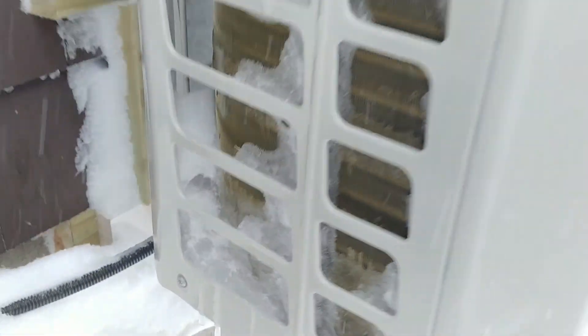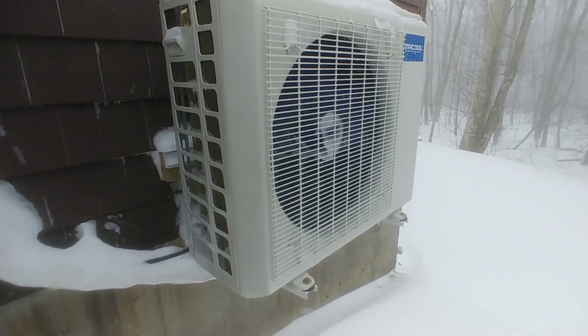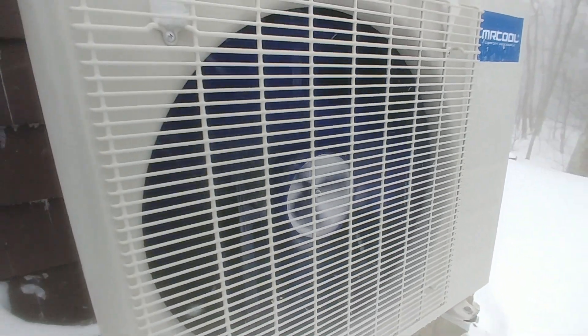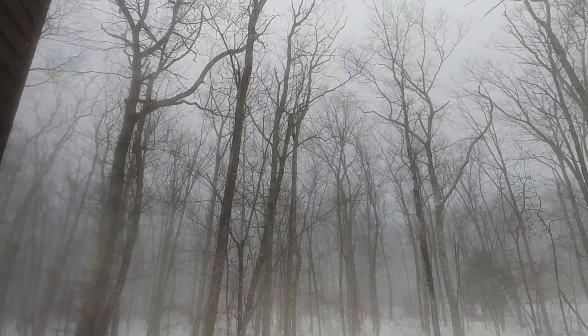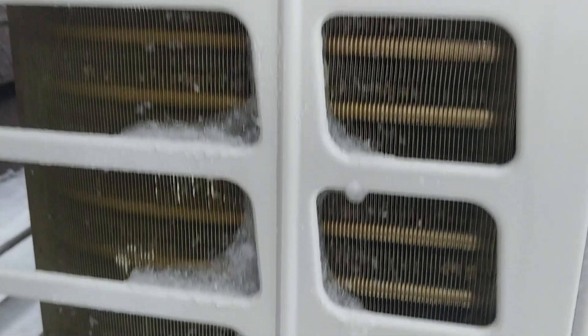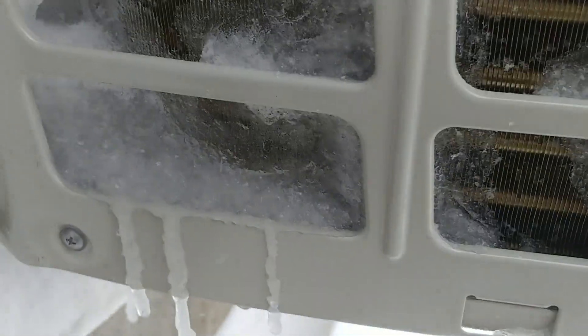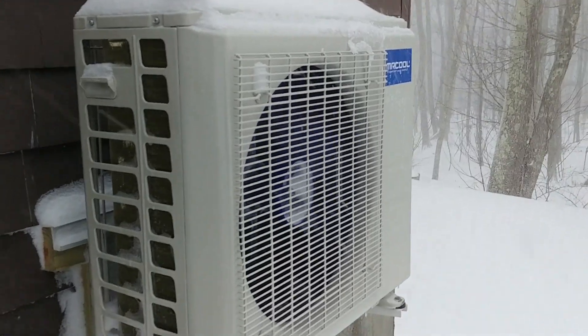Not too bad. But again, I'm curious how far it'll go, or how it knows. I really don't know. Okay, so it just finished the frost mode and it's back into heating mode. And I wanted to mention that it's 16 degrees and, again, blizzardy out here. So these are pretty extreme conditions to be used in something like this. And so how good of a job did it do? Pretty good. All the way at the bottom here, there's a little bit of ice left. And then up here, it's good all the way until the bottom again. But you can see that it's immediately sucking in snow and freezing — so that's just what happens, because it's colder than the ambient air. It's pulling heat out of this air. Crazy. It works as it should. Imagine that.